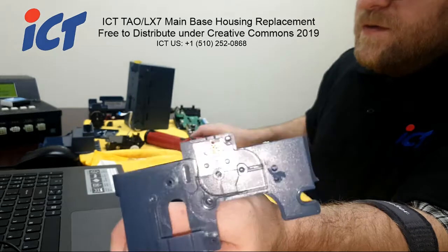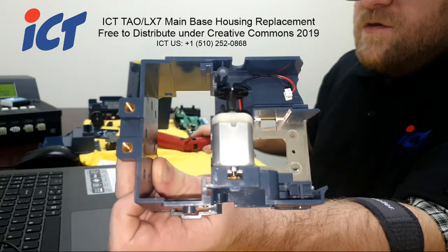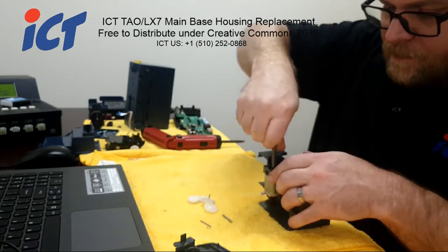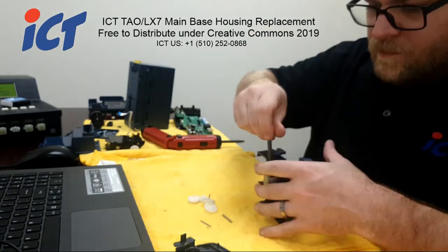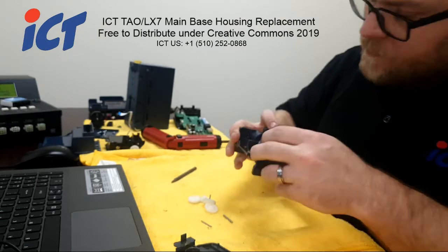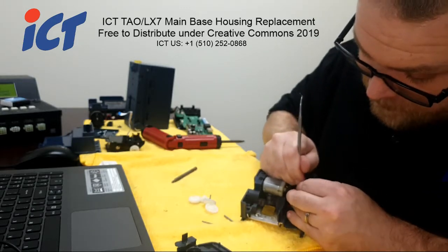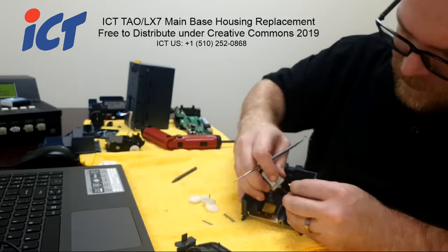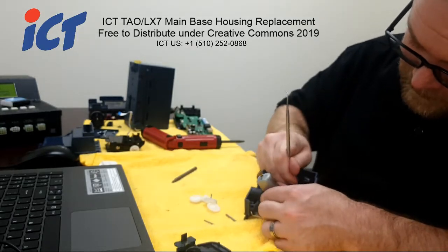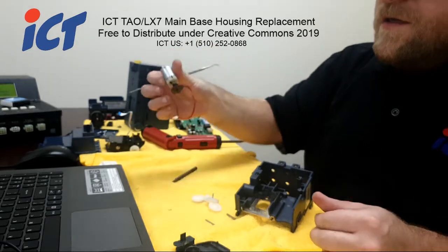With all your gears out, you have those two 00 Phillips screws that hold in your actual drive motor. So go ahead and remove those. And lower wire hooks for the drive motor. And get your drive motor off to the side as well.